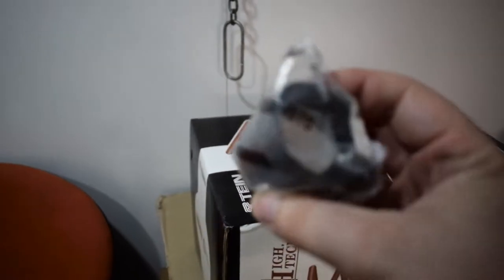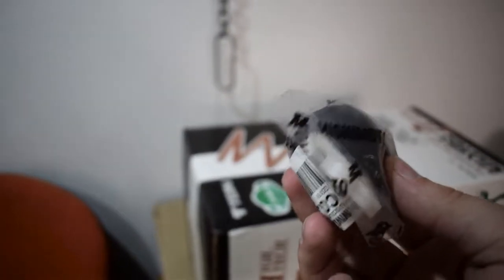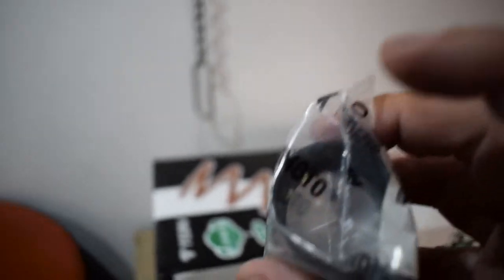This is a Mishimoto sound deleter kit. Essentially you've got a little rubber fitting that goes on the side of the intake — I'll show you guys once I install the Mishimoto kit when it gets here. Inside you've got a little bung. This metal bung goes inside the driver's cabin underneath the carpet right at the back, where there's a little hole where the sound comes through — you put this in and it stops it. Since we're not installing the Mishimoto kit yet, I need a stopgap. I picked this up off one of the forums. In the GT86, BRZ and FRS you have two 12 volt sockets — one in the glove box, one in the centre compartment. The glove box one has a cap which fits perfectly into the hole in the driver's side and will bung it up for the meantime.